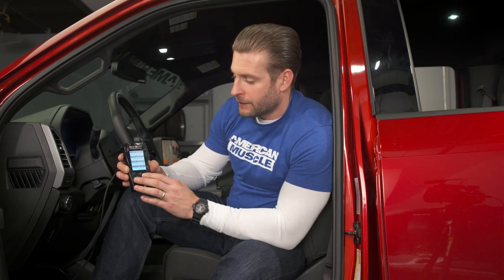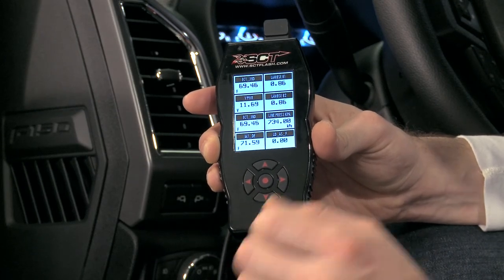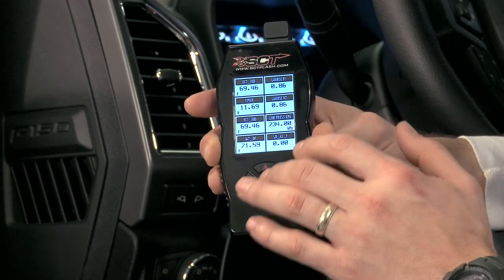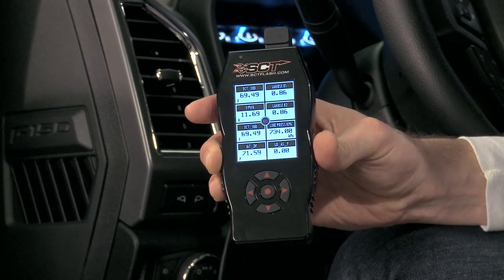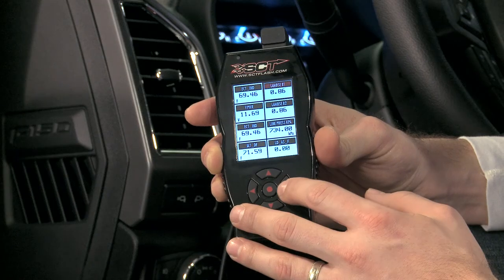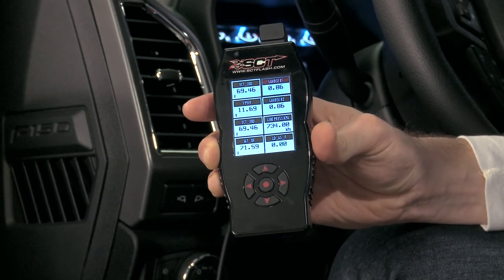Personally, I like using it in vertical mode, and I found you can buy the suction cup mount or use a holder for your iPhone — works perfectly in there. Now if you want to data log, if you're making a wide open throttle pull and want to review some data logs to see what the truck is doing, it's very easy to do. Set up all the stuff you want to data log, and when it comes time to record, just hit that middle button — you can see the record button flashes up. You let it go as long as you want and stop it at any point by hitting the center button again. This is something you'd probably want to offload onto your computer to be reviewed by your tuner.